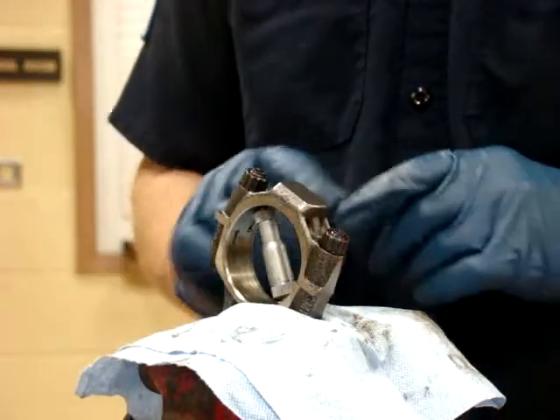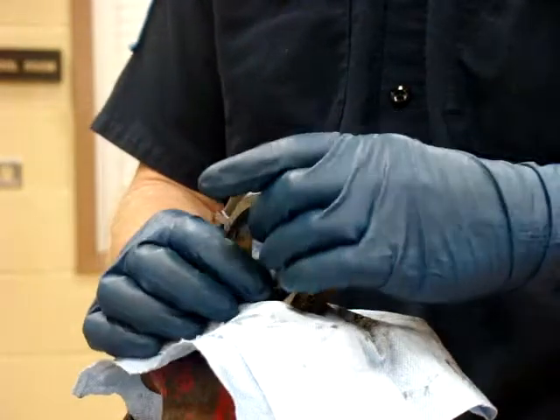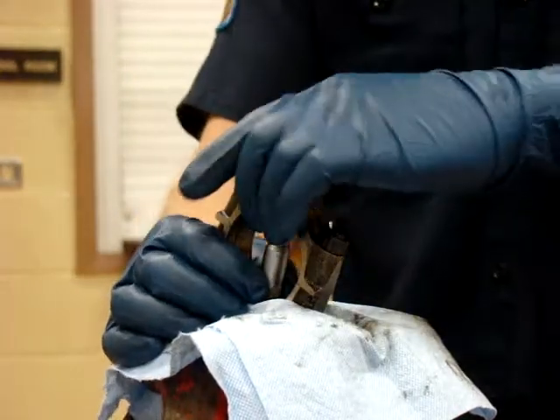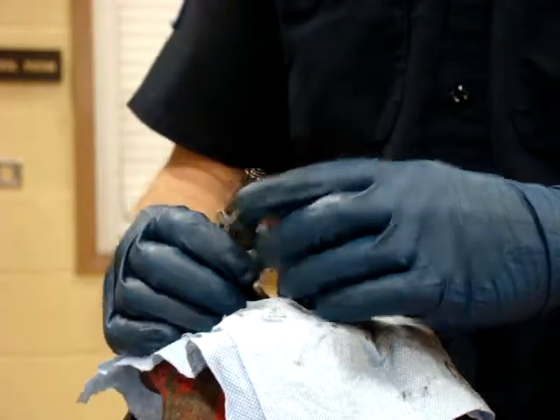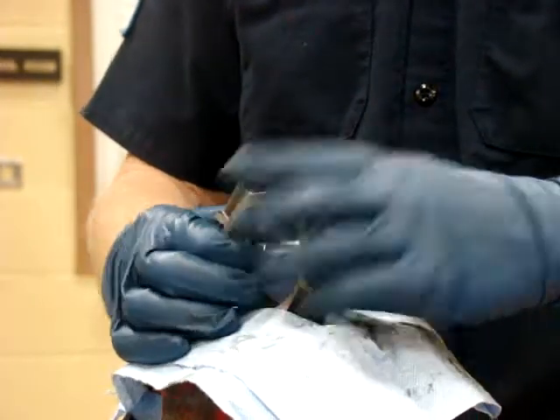We need to check it by three different places. They'll most likely stretch the long way, so we'll measure it here, take our reading, then turn it and measure again to see if it's the same measurement. If it's the same measurement, the hole is round and this part of the connecting rod has passed its inspection.